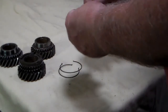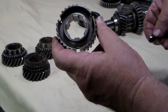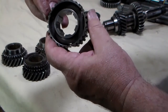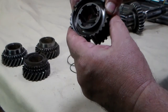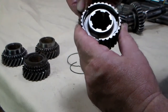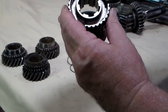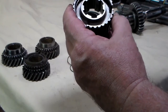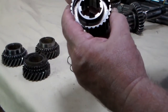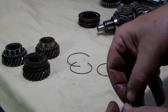What tends to happen with these springs is the synchronizer plate fits inside here like this and it rides on that spring, pushing in and out. Over time, the edge of that plate can cut two grooves in that spring — see the two edges of the plate. Inspect that spring if you plan to reuse it; make sure there are not two grooves cut in it where the synchronizer plate has been riding. If there are, it's time to replace that spring and find somebody who can supply you a good quality spring.